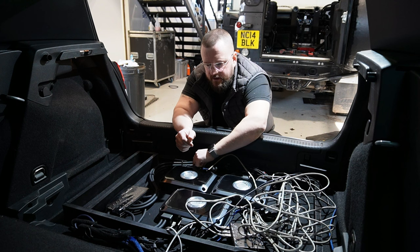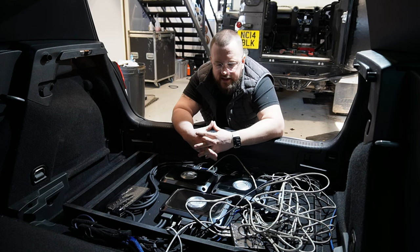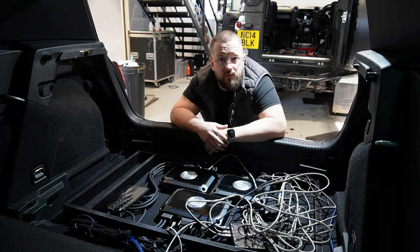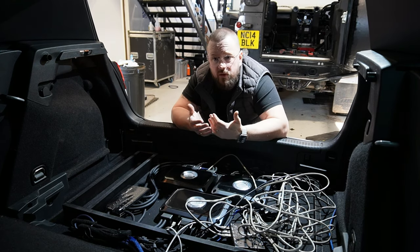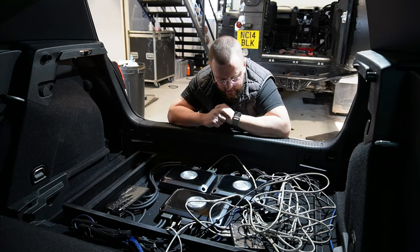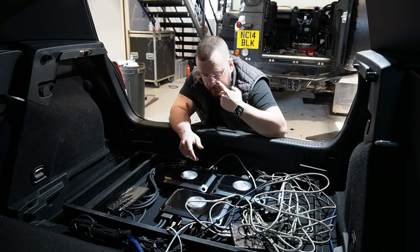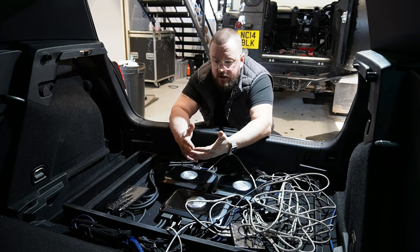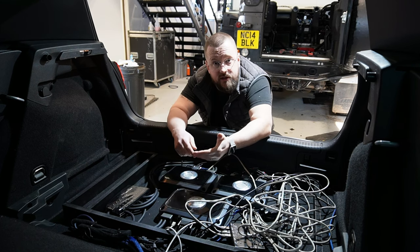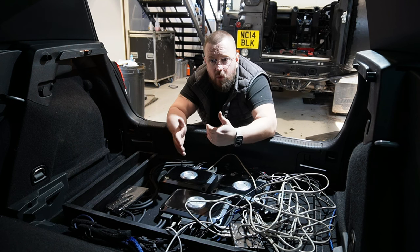These plugs are effectively noise-free — everything's separated and isolated in the way they intended. There is some stock in why they're like that. Build-wise, these cables are all rock solid and braided really well — quite hard. I cut off the RCAs to the 606 and soldered hardwire for the high-level inputs, because I didn't want to solder RCA connections onto the speaker cables and create more solder joints. I thought I'd remove eight solder joints and add two rather than having eight.